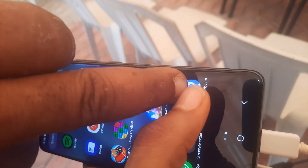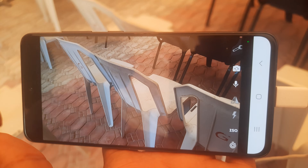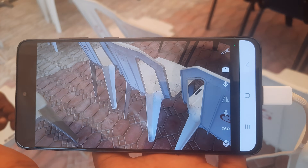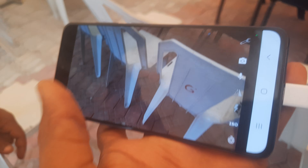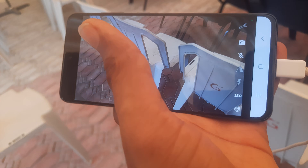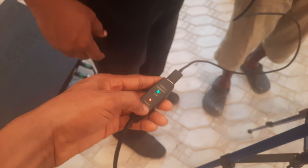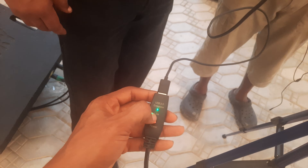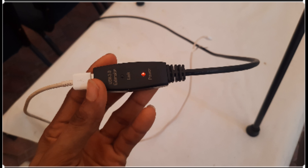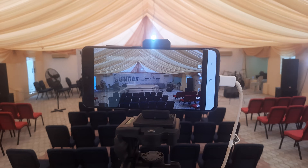Once you plug in the other end of your charger into your phone, open the Ethernet webcam. Because USB debugging is already enabled, this is what you'll see on the screen — make sure the male part is plugged into your system. It's successfully connected. Now turn off the mic icon because we are not using the phone microphone; we're using the sound card. We don't want the Ethernet webcam sending audio from the phone microphone to the system. To confirm the connection is successful, make sure the green indicator is showing. If only red is showing, it means it's not connected. Green means the connection is successful and the system is receiving the signal from the phone.